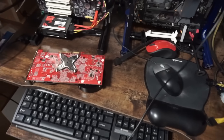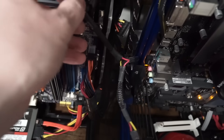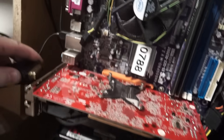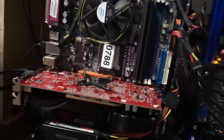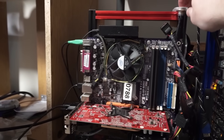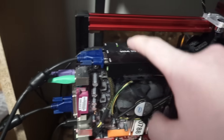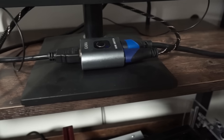I ran into a problem where this old AGP slot card somehow managed to get a more modern PCI Express connector, which this old power supply does not have, so I'm gonna need an adapter. On top of that, if I power the system with a DVI cable connected to the graphics card, the motherboard will not power at all. Maybe if I use a motherboard video through RGB, through the RGB to HDMI converter, through the HDMI switch into the monitor, would it work?